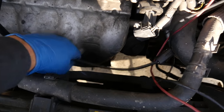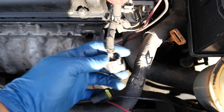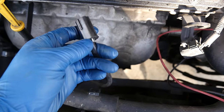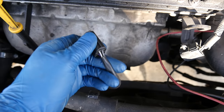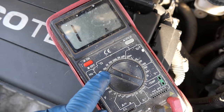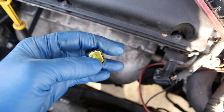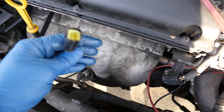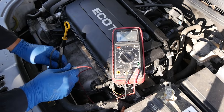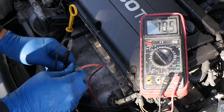On Paul's car, he has the O2 sensor with a four-pin connector, and on the harness side the connector has broken off, leaving four wires hanging out. Starting on the O2 sensor side — out of these four wires, two are going to the heating element. We can find those by using our multimeter set to ohms, and measuring resistance between all combinations until we find two pins that give us an actual resistance. We got 10.5 ohms of resistance, and we can trace those two pins back — on this sensor it's the white and purple wire going to the heating element.